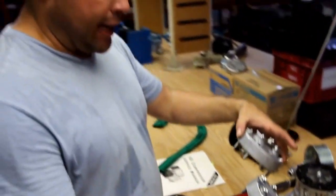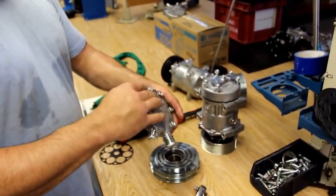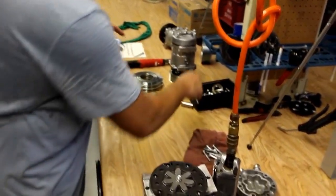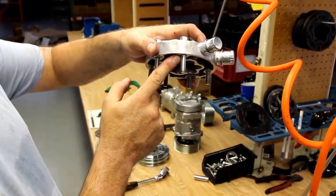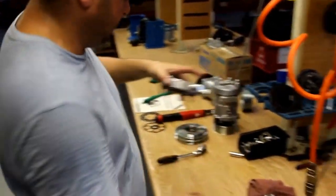When you are changing a backhead from one to the other, you need to be very careful and watch the lengths of the bolt that you're using, one versus the other. If you have too long of a bolt, what you will see is the unthreaded portion of the bolt will be exposed. That's your sign if you've got the incorrect bolt sizes.